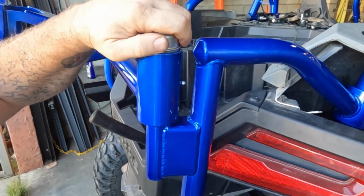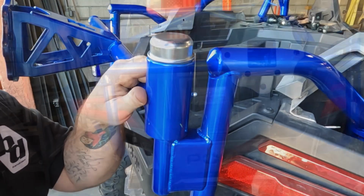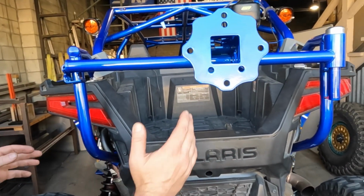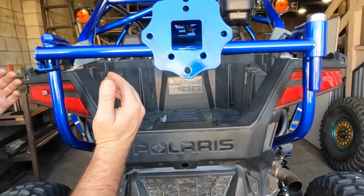If this ends up getting a little deformed, that's okay. It's just a small tin piece. So the next step is aligning, and this is probably the most crucial part. You could start off by just looking down the hub face and your center of vehicle, and you could tell that this needs to come over.